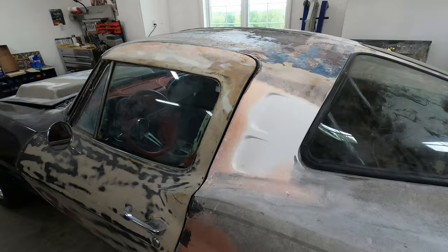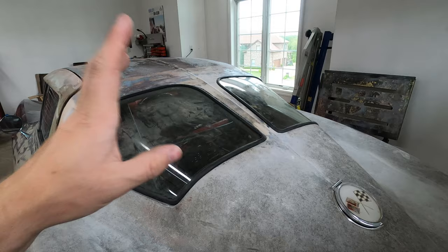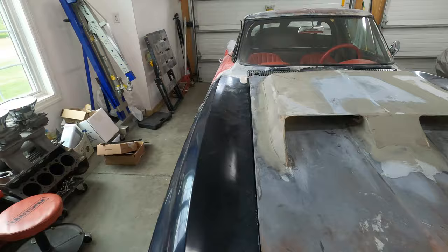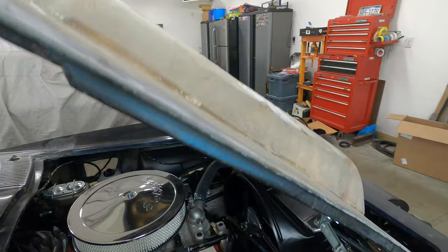I've been working on body work in this area, especially around the rear windows, because I installed both rear windows. They fit a little bit snug so I'm not sure how trim would fit — I think I still need to play with this one to get it to sink down just a little bit more, but they're fitting really nice. I took the driver glass out and replaced a seal so that the glass actually stays connected to the regulator, and I got that one working. I'm test fitting the hood right now — I need to modify the hinges a little bit to allow the hood to slide forward because there's a pretty monstrous gap right here and it's really tight in the back.